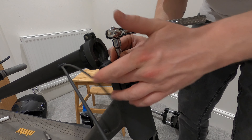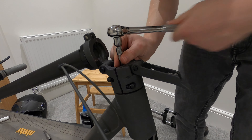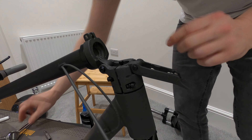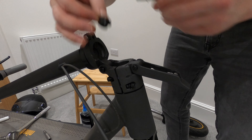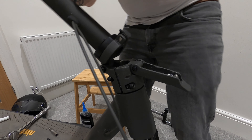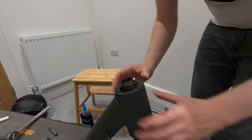Now those two are loosened off, it just takes the clamp away — you don't have to go all the way. Then we're going to take this main bolt out in the center here. Great, that's now out — put that to one side out of the way. Bring in the stem and we should just be able to lift it away and pop it to the side. We don't want to lose any bits and pieces, and we're left with that.